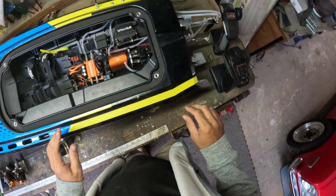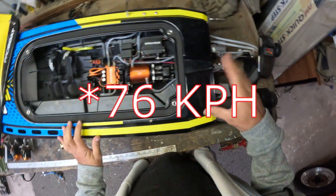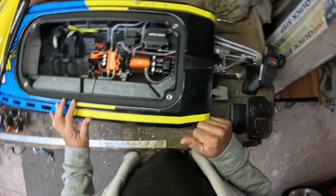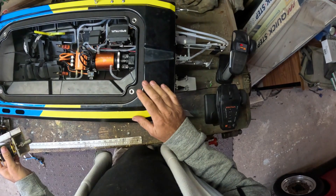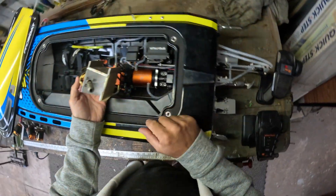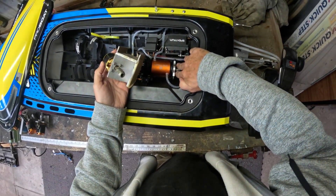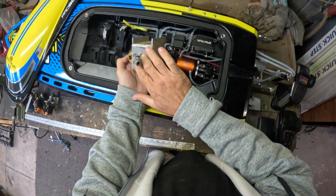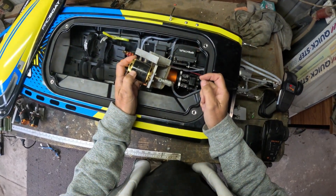So I've got the baseline speed of 67 km/h with this setup. I'm sure it could go a little bit quicker if I made the boat run looser, but that's not what this is about - it's comparing one motor for another. I don't actually think this Scorpion motor is going to fit in there. Looking at the bolt spacing, it's probably a 35mm or 30mm bolt spacing whereas this looks like 25mm, so I may not be able to do this motor swap, which is unfortunate.